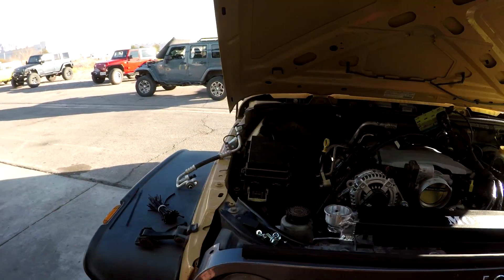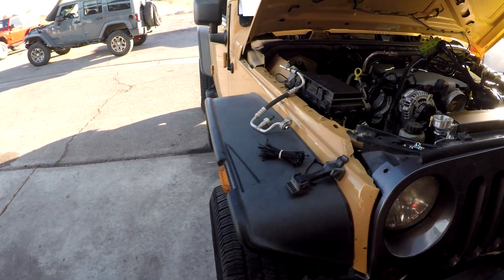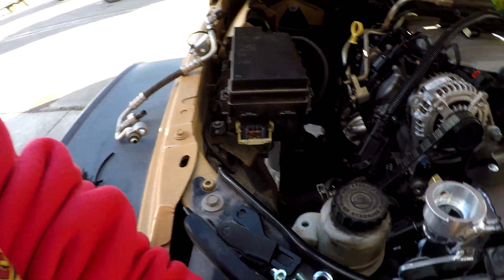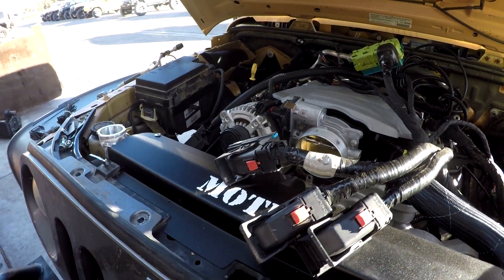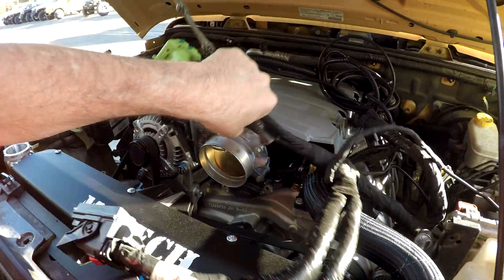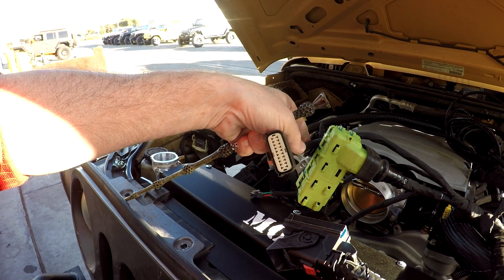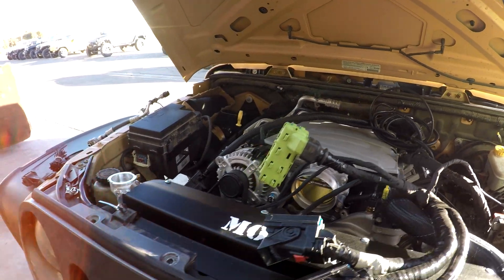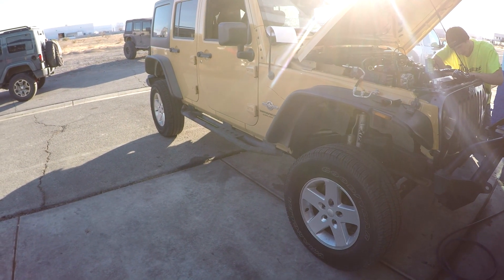Dustin is working on an LT1 — wow. An LT1 in this Jeep is going to be fun. Those tires won't have a chance, even in four-wheel drive. It's already got our battery tray and dual-header radiator. We're running the factory harness on these — right from GM — and we're even plug-and-playing the power distribution center. There are two connectors: one interior and one chassis. The factory GM chassis connector goes back to one of the O2 sensors, the vent solenoid, fuel tank pressure sensor, and some other items — exactly how GM does it. A JK this light with an LT1 is going to be very fun.